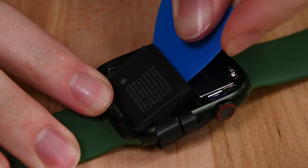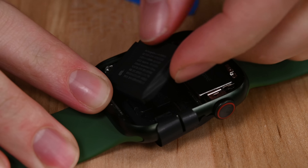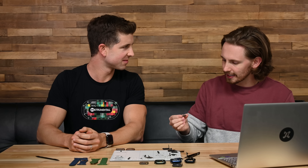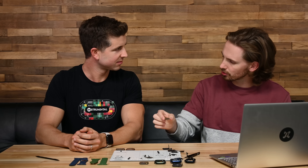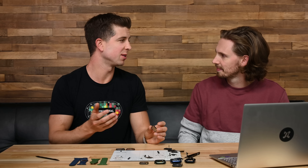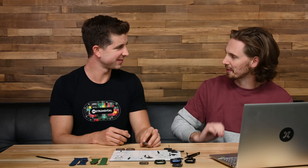Moving on from the display, removing the battery still requires some close-quarters prying, but the adhesive is mild enough to lift the battery without deforming it. The smaller 41mm battery still has a nice metal pouch to keep it safe. Both S7 batteries get a small watt-hour increase from their S6 counterparts, though that doesn't translate to any increase in battery life. Why does only the smaller Apple Watch get the battery with the metal pouch? It's likely a newer technology that was introduced, potentially allowing more energy density in a smaller form factor — required because of the design constraints of the smaller watch. There was probably an increased cost for this new technology, so they used it on the smaller watch but it didn't quite justify it on the larger model.